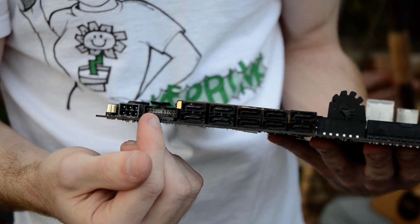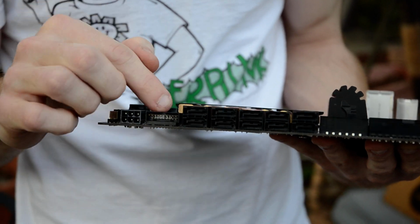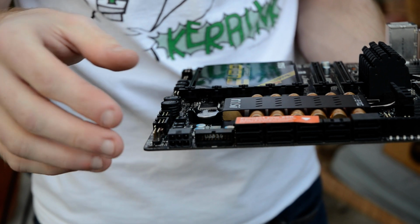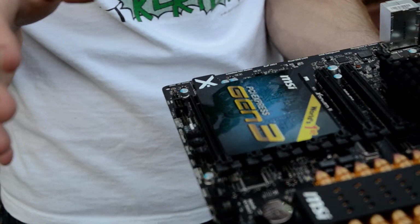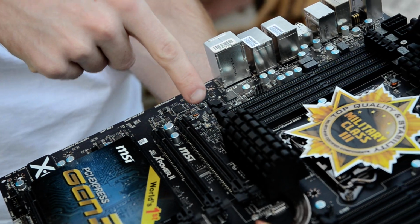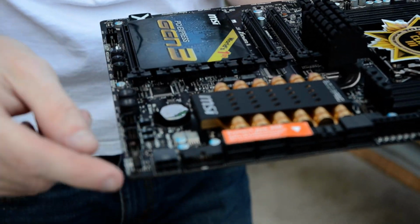And we have a USB 3 front panel header, which is in a great spot, and it's facing parallel to the board. And the same thing with your PCI Express Xpower plug. Normally, like on an EVGA board in particular, it's up here. There's no possible way you can do a good clean cable management job. This is up here. So this is a great spot for it.